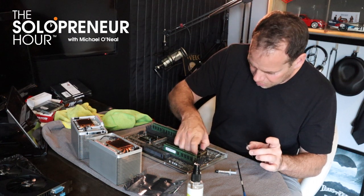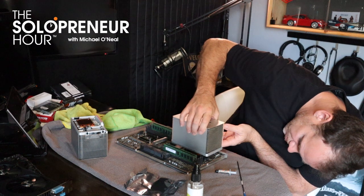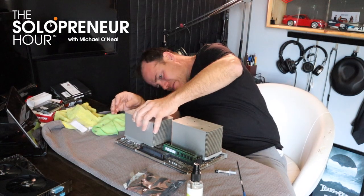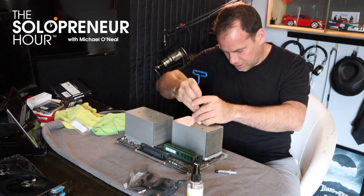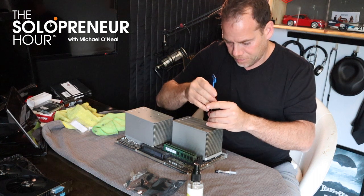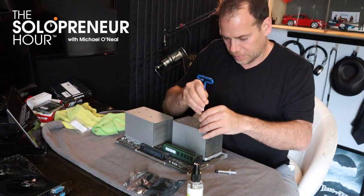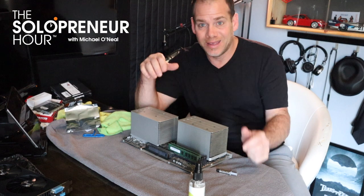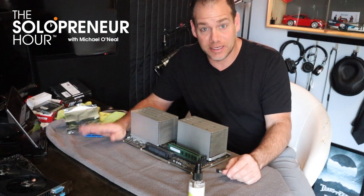I've moved this CPU so I need to put it back. The heat sinks have a little plug at the end - make sure the plug lines up, and there are four holes where the screws go. There's one and there's two. Now you tighten in a cross pattern like you're doing a wheel on a car. Snug them down until they're just making contact, then tighten a little bit - you don't crank them, you're just looking for nice even pressure. With that, the CPUs are in. I hope I have them evenly tensioned. I can slide this whole tray back in now and get to work on the rest of the computer.